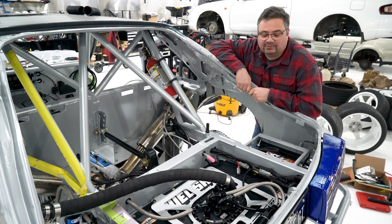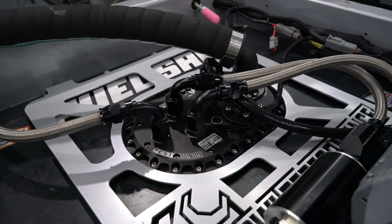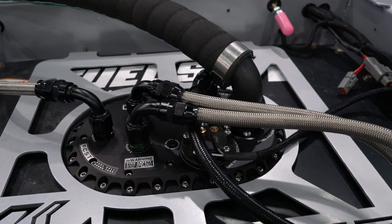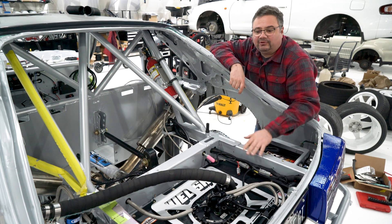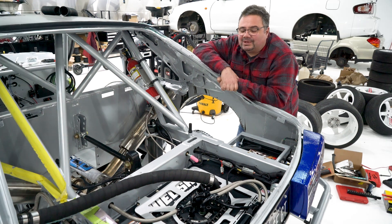In the back, we put a Radium surge tank in the fuel cell — it's a big can with a little lift pump that fills it. The surge tank has check valves on the bottom, two dash-10 pickups going into a Y-adapter, then into a Weldon filter, then dash-12 into the Weldon pump, then dash-10 PTFE out to the engine and return back into the tank. The fuel hose is mocked up for now and we'll finish the sheet metal work back at my shop. We need to wrap up some wiring, do bodywork and paint — hopefully by mid-February we'll be at Barber doing testing, and our first race is at the Charlotte Roval towards the end of March.